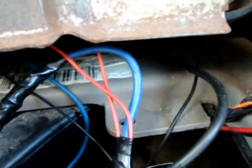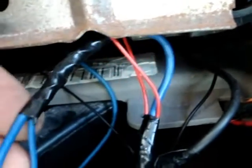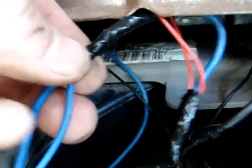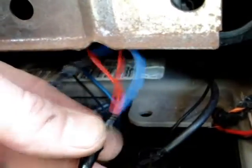And then there's my two powers. There we go. There's my two powers for my forward LEDs, soldered into the same line that goes to the back. I took the liberty of running the battery gauge that I have installed to run that power into this as well. Not creating a lot of load on this line. So there's the inside done. Pretty basic, pretty simple. Ground, wire, and that's it. You see it ends right there. Everything's all tied together, soldered up nice and tight.